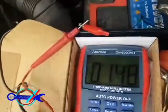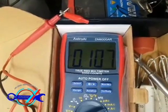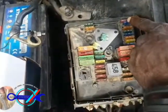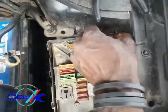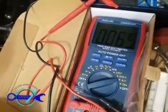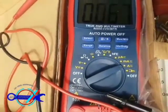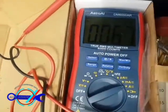You can see the reading I'm getting right now — it's 1.07 amps. I think it will still drop; it takes a little bit of time. Another culprit I found within this circuit is this 15-amp fuse. Checking the wiring diagram gave me a hint — I believe it's related to the cluster gauge. Just look at what happens immediately when I pull that fuse. I also recall there was an error code about the instrument cluster. So don't forget the cluster, the ECU, and the central door automatic locking on Volkswagen models when looking for battery drain issues.